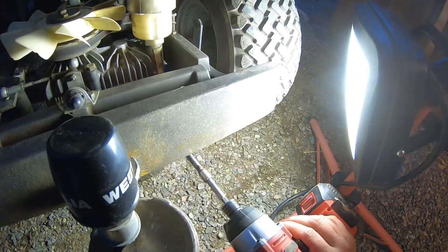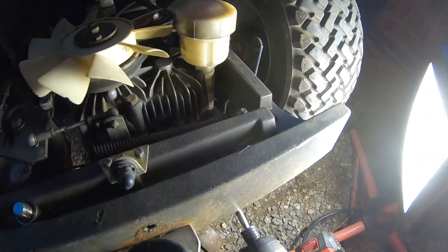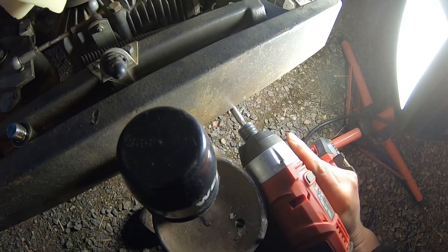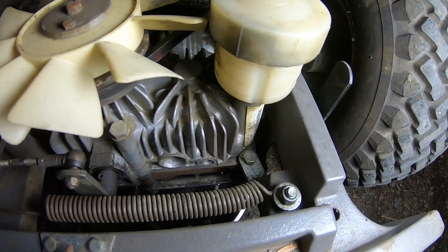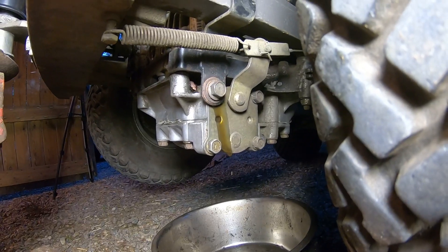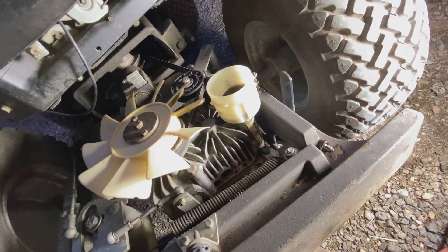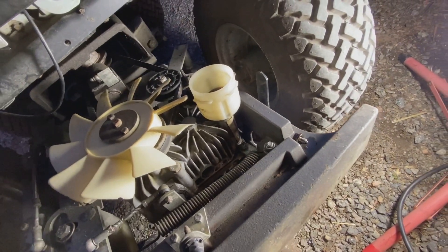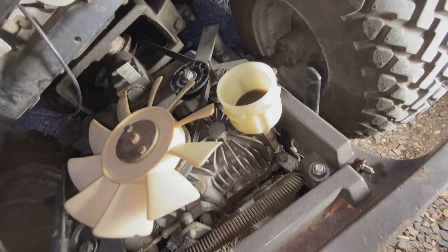I'm using this because sometimes you need a little bit of a punch to get it out — I just got it out. I hope it's not going inside the brake. So if you turn this you can get the oil out faster. I have the bypass on like I would roll it, then turn one of the wheels backwards while holding the other wheel.